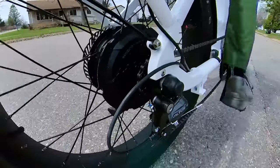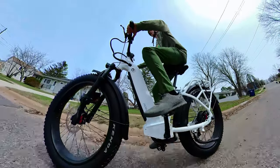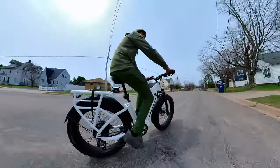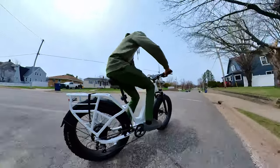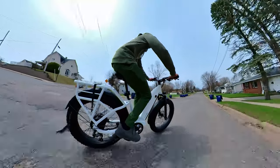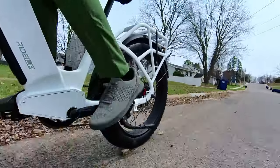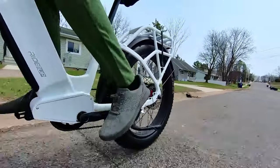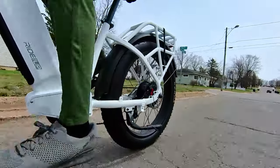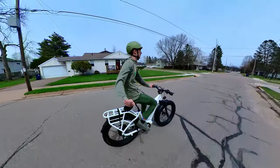The ability to customize motor power in each pedal assist level is an underappreciated feature. Powering the 750-watt motor is a 48-volt, 20-amp-hour battery tucked neatly into the frame. That capacity isn't unheard of at this price, but it is a large pack. Ride 1 Up's stated range is 45 to 60 miles — the high end possible on the lowest pedal assist with plenty of your own effort. The rear rack welded right to the frame with 150-pound capacity is more capable than most, good for passengers with their kit or just worry-free cargo loading. A Connect Plus basket or Ride 1 Up panniers are optional accessories linked in the description.